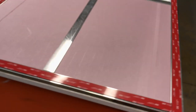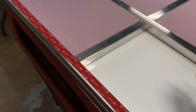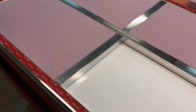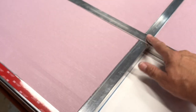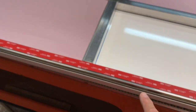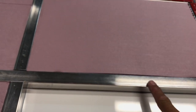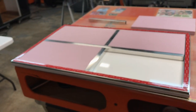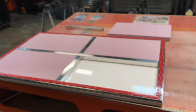Now, one of the other things I do once I put the back skin on this, so it's made from the inside out, that's the inside, and then the final skin, which is there, will sandwich right on top with more tape. And one of the final things I do is rivet both as well on the ends, and just a couple in the center of this door, so that it definitely doesn't go anywhere. So it's very much, short of welding, made in the same nature as aircraft.